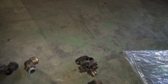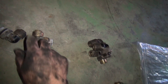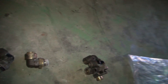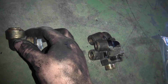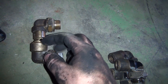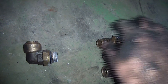These here are all the same, and these are the ones they replaced with plastic. These two here are check valves between your tanks — you need to pay close attention to this because you could put these in the wrong place and have issues. There's a check valve in there that air will go in but air cannot come back out. The rubber boots that slide on the end of them are one easy way to tell — see how big this is on the end versus the other, which is smaller. The check valve is a lot bigger, and that'll be an indication if you're not paying attention when you take your old fittings out.